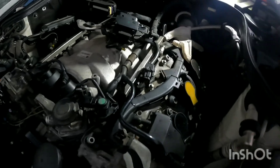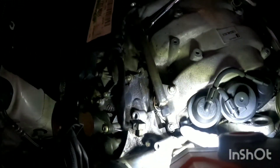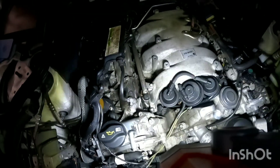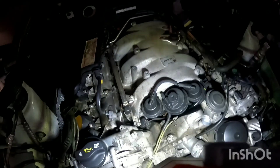It will be easier to take all the injectors and everything out on the intake. After that we're going to have four E10 sockets, one on each corner — one there, two here, three here, and the fourth one in the back. Four on each side — we're going to take those off and that should let the intake come off.